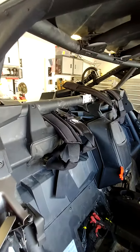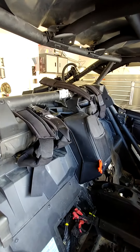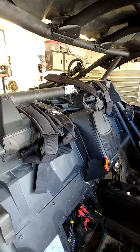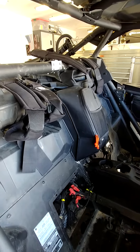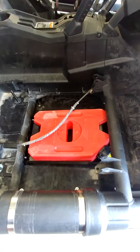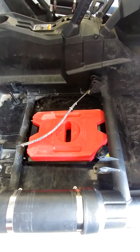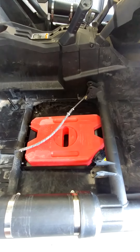The Arctic Cat old Wildcat used to put the tank over the rear engine. And quite a few people actually put spare gas on the back of the roll bar. That's okay most of the time, but if you roll or have a leak, it's sitting right over the motor, which easily generates a fire potentially. With this setup, if it leaks, it's not going to land on the engine or on you.